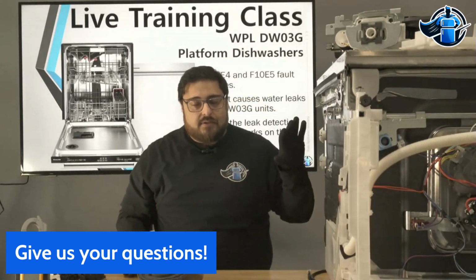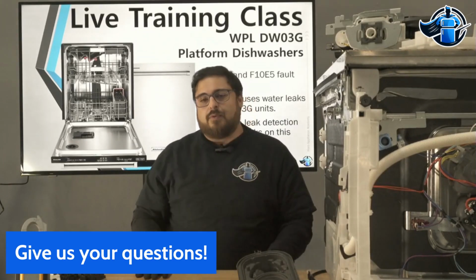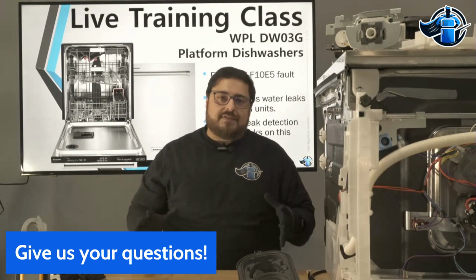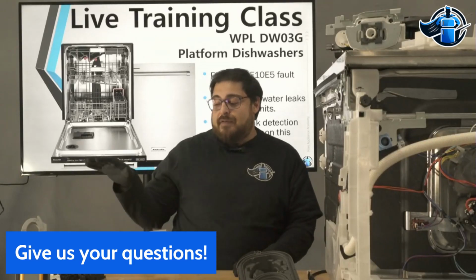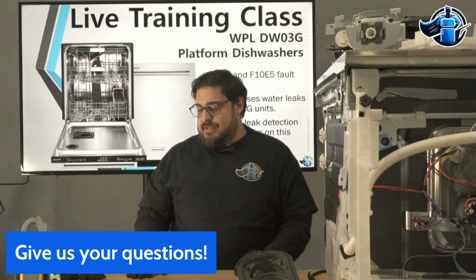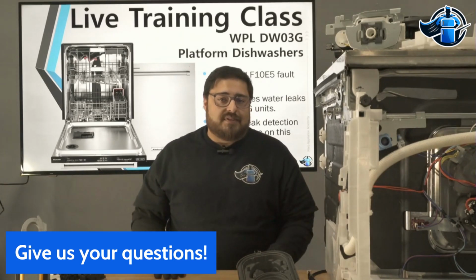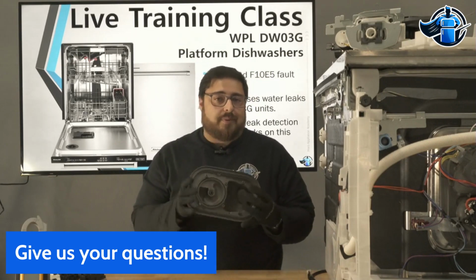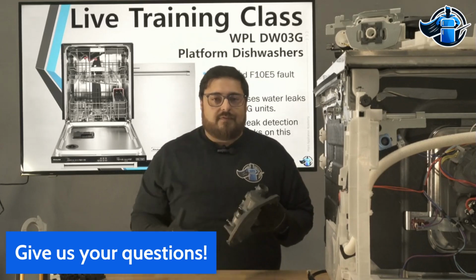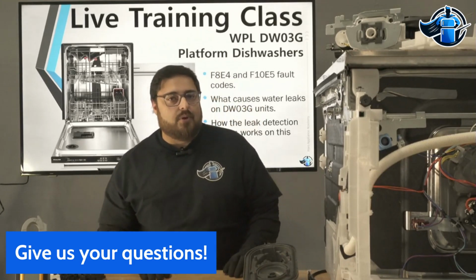But as far as these go, those are your leak potentials. Again, replace your full sump assemblies, recognize your leak points on your diverter leaks. If I'm seeing an F10E5, that should be a really easy check to make directly at the control to see if you've got resistance on those pins. And then at that point, we're looking at replacing the full sump assembly, because I would not recommend replacing just this sump. As you saw the potential leaks, just replace the full sump assembly, call it a day. So if you've got an F10E5, that's what you're looking for.